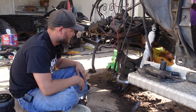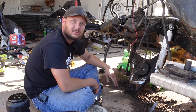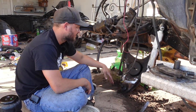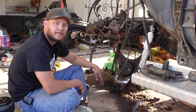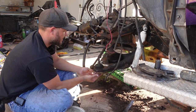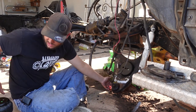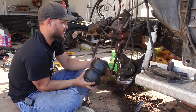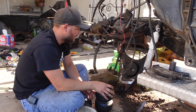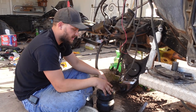They look at the bottom plate — that's the airbag, and it just sits there in the lower control arm. It holds pressure on the airbag. The control arm holds everything together, so the bag can't go anywhere because it's stuck in between the two plates. The bag has a hole in the bottom and gets bolted to the plate, and bolted to the top plate too. Then you slip the whole assembly down in there, jack it up, put your control arm on, and you're pretty much done.